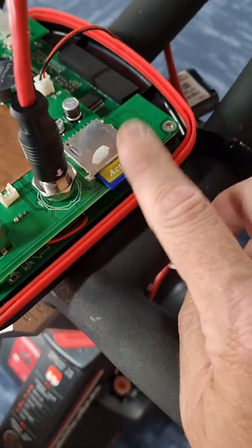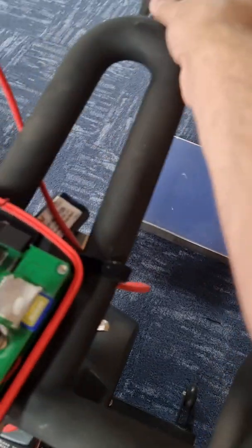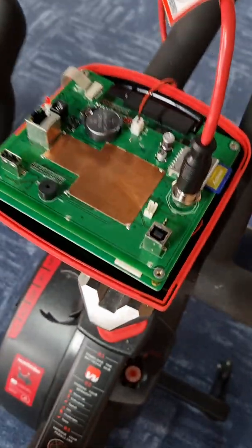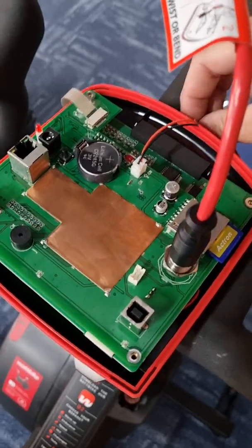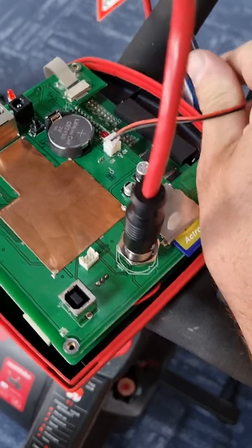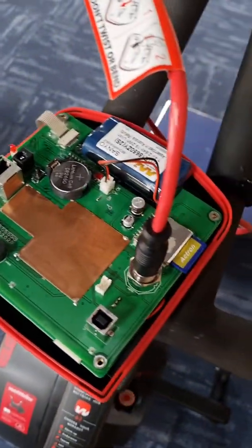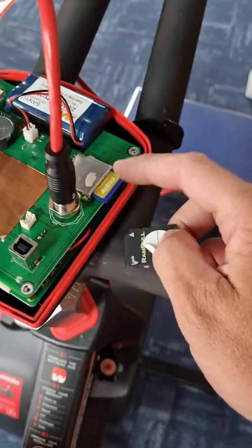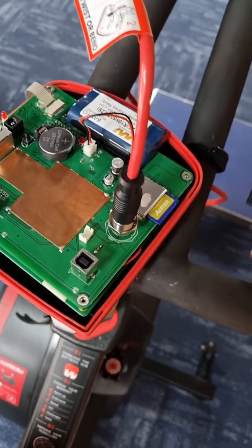The fix is simply that you need a new SD card. Take it out, plug it back in and try that first; if it doesn't work, get a new SD card because something seems to be wrong with it. This is a follow-on video from the battery video — it's actually the same bike, so it had a two-stage issue: first the SD card fault, and then when I pulled off the console I also tested the battery voltage.